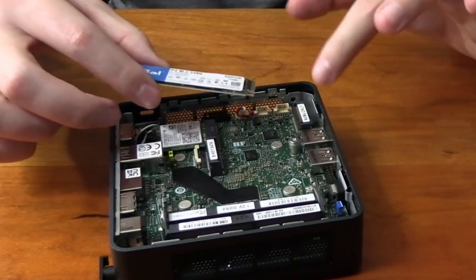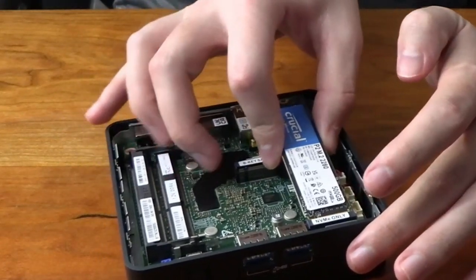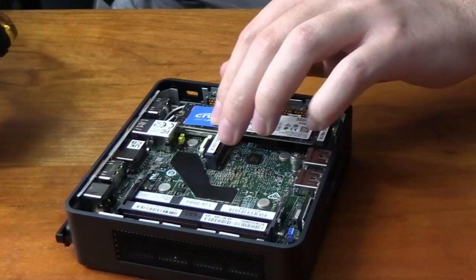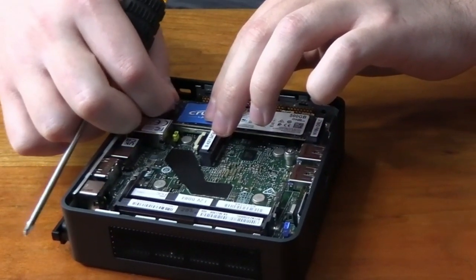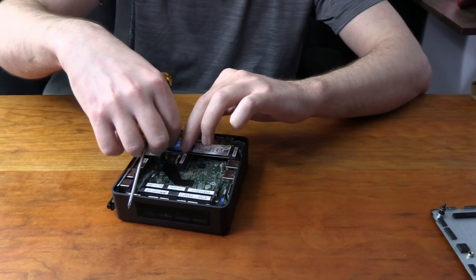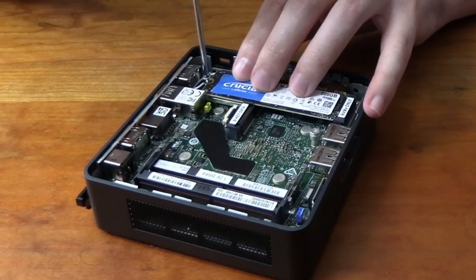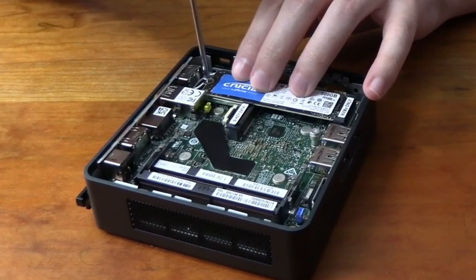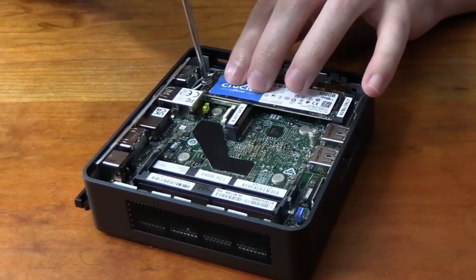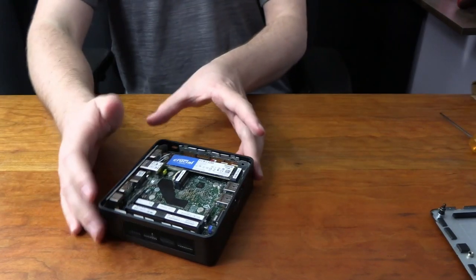Put the teeth right here with the teeth on the inside. When you line it up you can see the NVMe label facing forward with the teeth — just let it bite. There we go, now it's bit. All you have to do is apply pressure downward, then grab the same screw from earlier. It's pretty simple — it's just stacked on top of the drive that's already in there. Put that in place, add a little bit of pressure until it bites, then add more force and screw that down until it's secure. NVMe is installed.